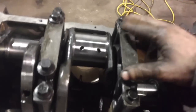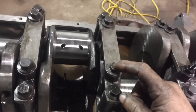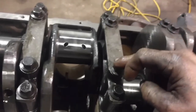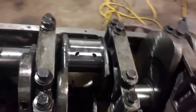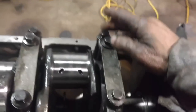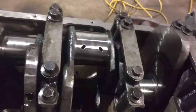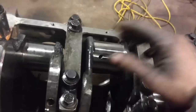The tightening sequence — first step is 76 foot-pounds using a 15mm six-point socket, always use a six-point socket. The torque sequence is kind of the opposite of what you'd think — they want you to do the outside ones first, which is weird. You'd think you'd do the inside ones first like on a cylinder head. Start in the middle of the crank, go one, two, three, four on the outside bolts first, then work to either side in the same fashion. So start torquing this thing down.